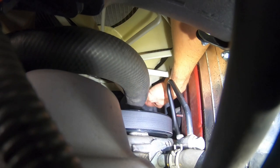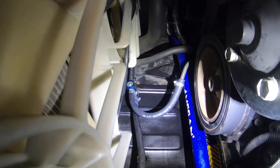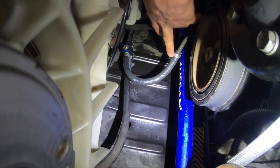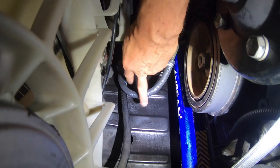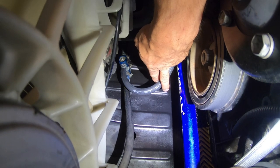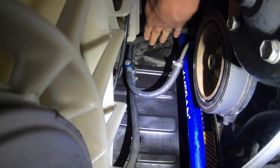The lines connect over to the thermostatic valve, which helps in winter because you can actually over-cool your transmission fluid. Make sure your temperatures don't get lower than about 170°F. There's my thermostatic valve right down there, and this is the transmission cooler return-to-transmission line hooked up — this should be the coolest line. The fluid has been cooled twice: once by the OEM cooler inside the radiator, and once by the external cooler I installed, before going back into the transmission.